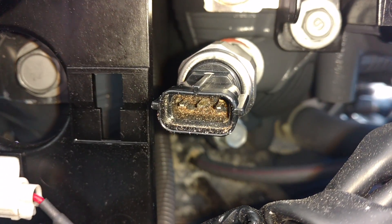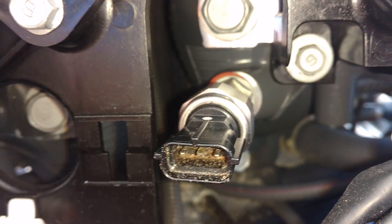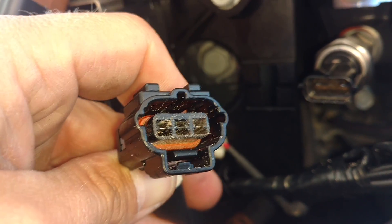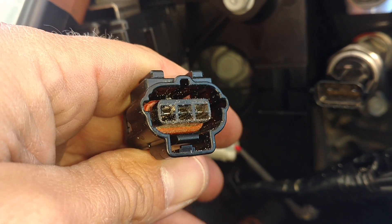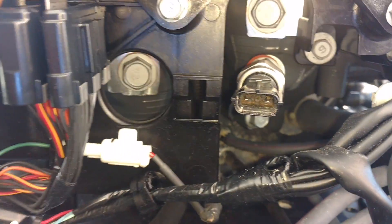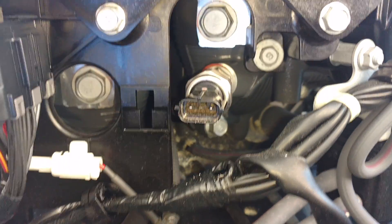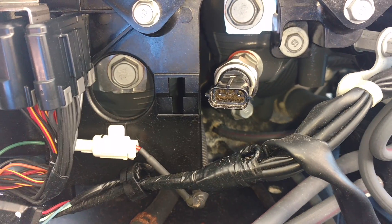What we can see here pretty easily is our water pressure sensor appears to have some internal damage — it's probably shorted. And let's look at our pigtail on the main harness, the engine harness rather, and you can see this looks pretty bad too. This is not normal. Any sort of buildup like this on these harnesses can spread issues back through the harness, give faulty voltage inputs through the entire system. It can go back into the ECU and then the ECU is dealing with a voltage issue when it's trying to handle all of its other decisions.